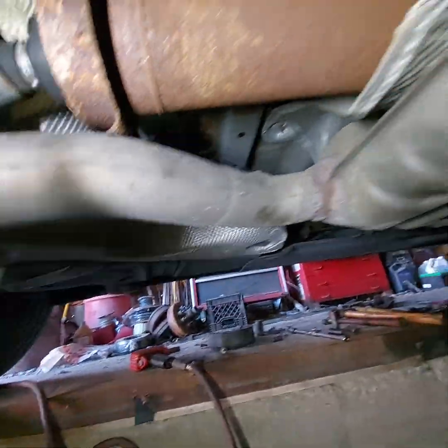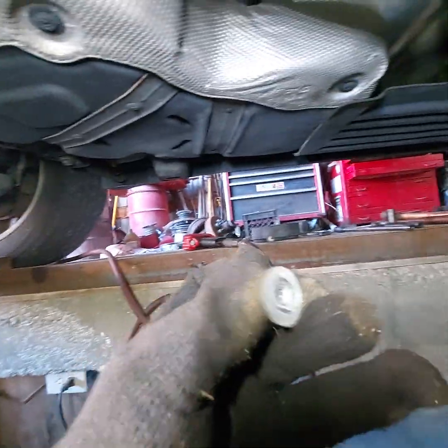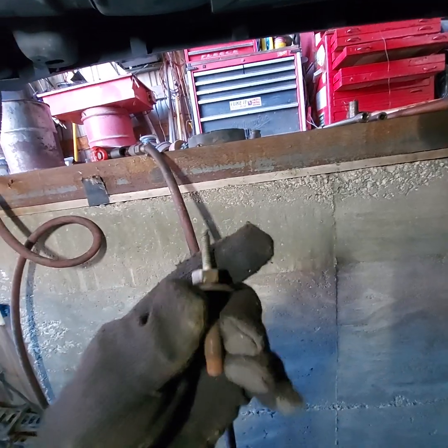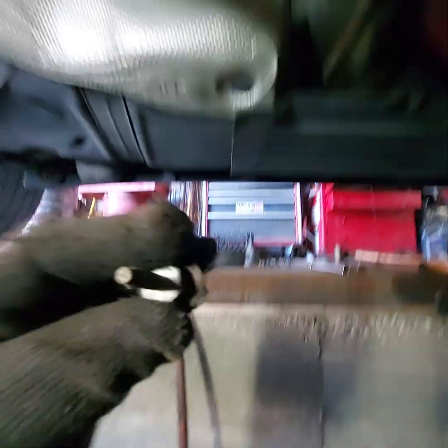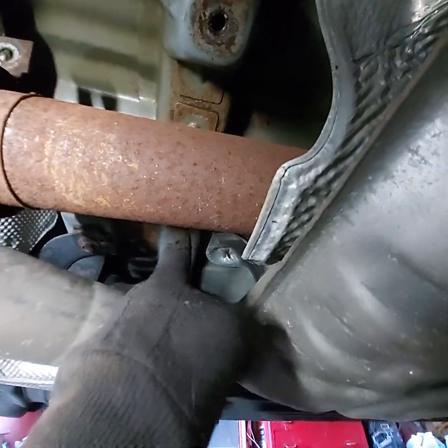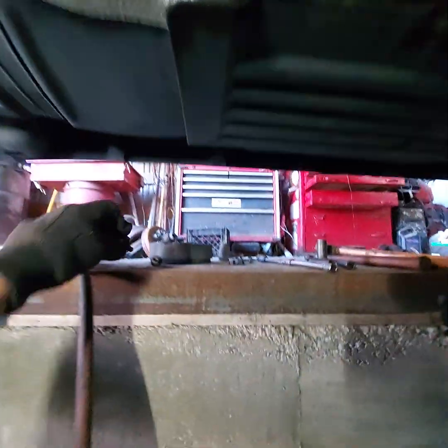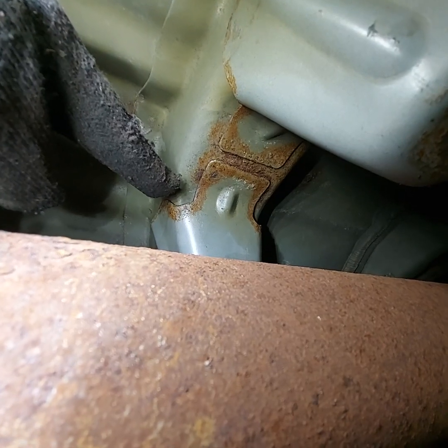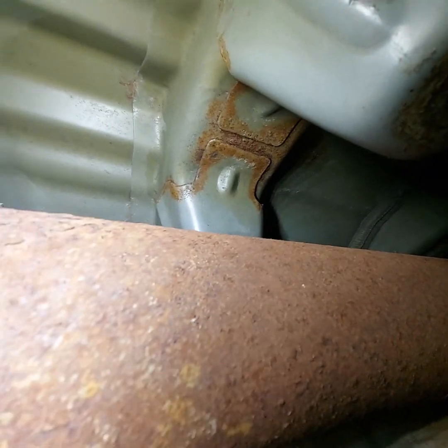There's a heat shield that goes over there. Two 10mm nuts secured that, and they went on this stud bolt. It went in those two holes. There's a hole on both sides, and because they was pretty dry and didn't want to come out, I stuck the jet nozzle up there inside that little hole and let that lubricant run down on top of the bolt in there, like right in there.